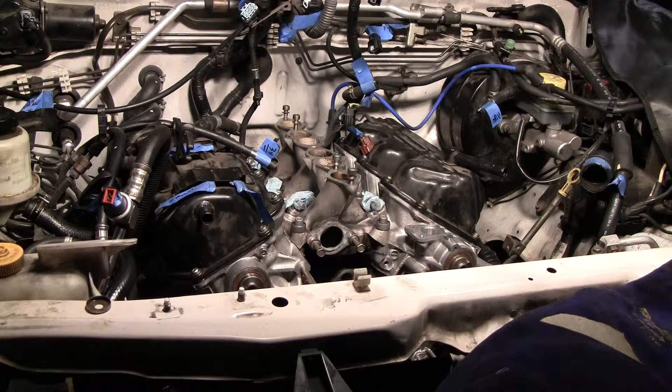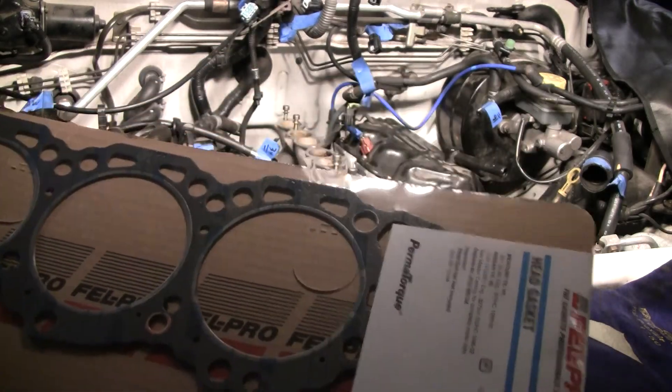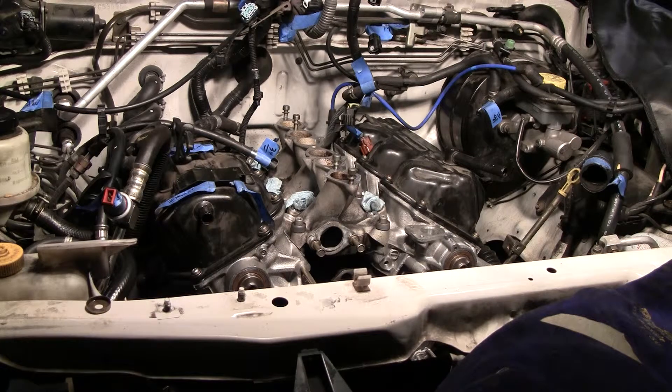On Monday I got another head gasket — exact same Fel-Pro. I know, two steps forward one step back. What I'm going to be doing — and I'll admit it to you guys — is ripping off the intake manifold as well as the driver's side head. I know it's all torqued down and everything's good to go, but I just can't live with myself leaving it like that.